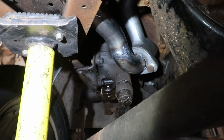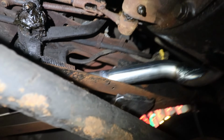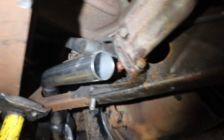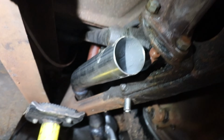And I just got a tack to the flange in there, but you can see it has to go uphill really fast and then turn again and then turn another time. I have another little 30 degree bend or something there, and then it has to weave around the master cylinder and the pedal. When the clutch pedal's all the way down, it just barely clears or might kiss, but doesn't really affect anything.